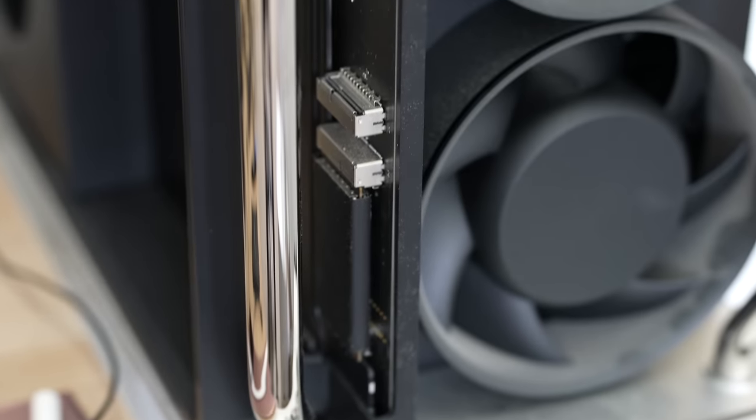They designed these to be able to add SSDs. The USB-C port holder is done — now let's remove this antenna because we need to access the screw below it. That's a massive antenna; no Bluetooth problems here, Apple made sure of that. Now I'm going to try to remove the four outside screws that hold down the fan assembly and see if we can just lift it up without having to remove all the ports. I'm really not looking forward to putting this back together before we can start benchmarking.